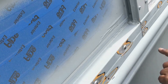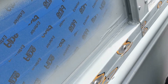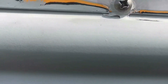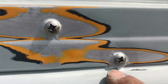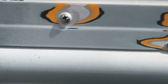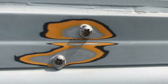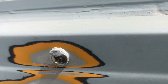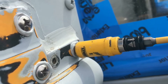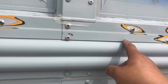Because I cut the tube big, I don't want to apply more until the end and I'll use the whole tube since I have a lot of holes anyway. Then I'll come back with a different tube. I'm cleaning that off with some mineral spirit — you can see I still have a bead there, but when I caulk it I'll just blend it in. On these ones I put less caulk when I dipped, and I kind of like this better because it almost has like a gasket effect. Since I'm painting over it anyway, I think that's gonna blend in very well. I'm gonna do all of them like that.